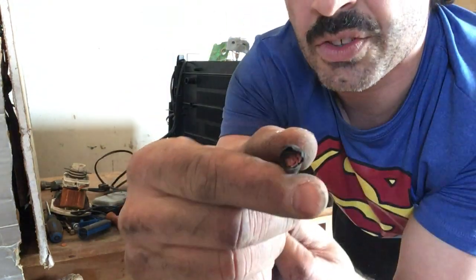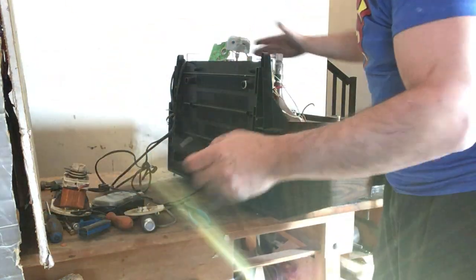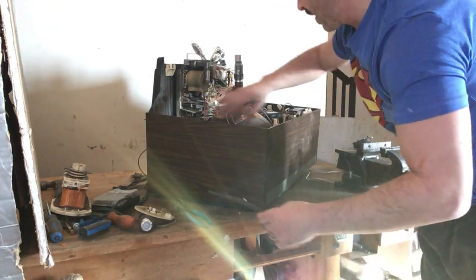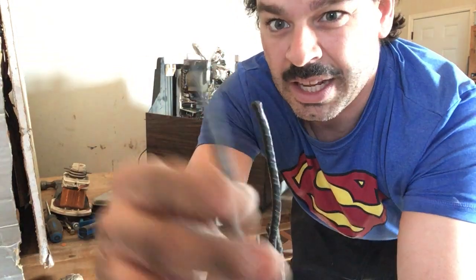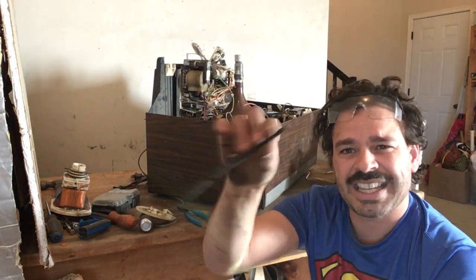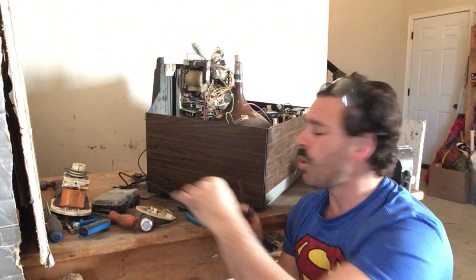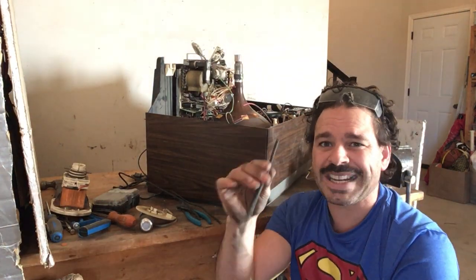The degaussing cable — you can see right here, just pull it up. I'm probably going to have to do some breakage because there is a small tin layer. I'll just cut this to show you a piece of it. There is a piece of degaussing cable inside — it's recognizable with the tape around it, and it goes around the whole thing. There is a coating of tin around this yoke. Once I remove that, I'll get the rest of the degaussing cable. This one is thicker because it's a larger TV — definitely make sure you cut inside to check: it does not reveal the metallic look, so this is number two copper once I remove the outer coating. If I left the coating on, I could just throw it in my 60% appliance pile.